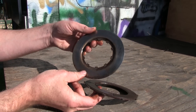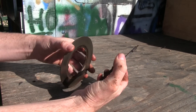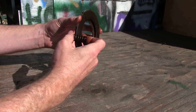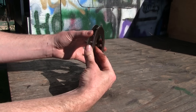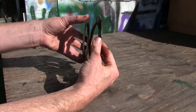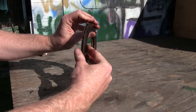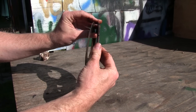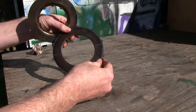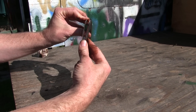These are the clutch plates — there's a steel plate and a friction plate. The friction plate has frictional material on it; one side is connected to the engine and the other to the transmission, and springs make them go together. When you step on the clutch, you compress the springs and separate the two plates so they can't touch. When you let off the clutch, they slam together — the friction material sticks to the metal and your engine is connected to your transmission. When the clutch is fully in or fully out you're okay, but in between — the friction zone — one plate is moving faster than the other, they rub, and that's what wears out your clutch. So in the friction zone, be as gentle as possible and do as little damage as possible.